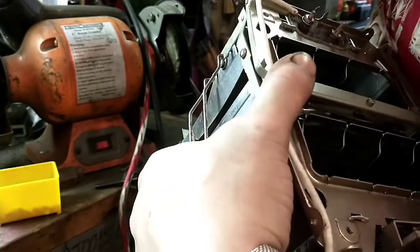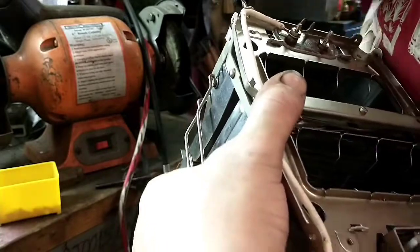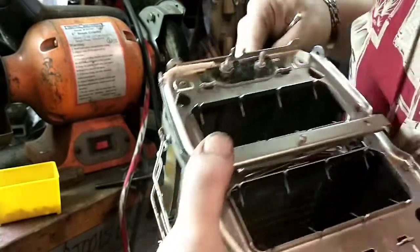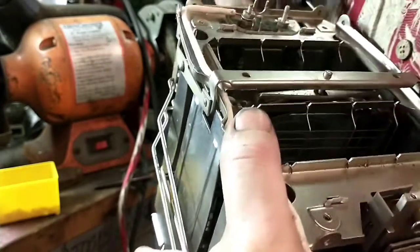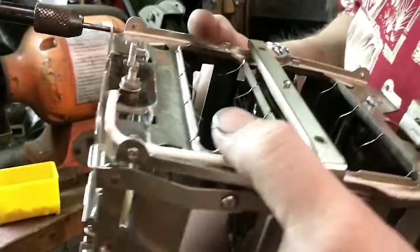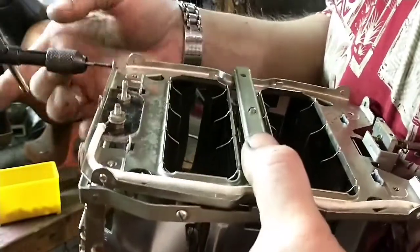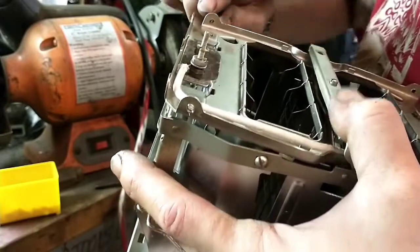Even by the 1950s, sheet metal screws were self-tapping usually, and a lot cheaper than machine screws, such as the ones I'm replacing the sheet metal screws in here with. So that's why you see those cheap sheet metal screws in something American-made from the 1950s. It didn't really affect any performance.